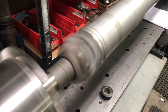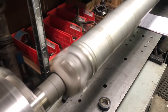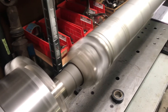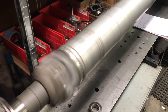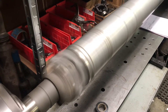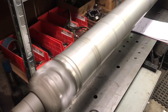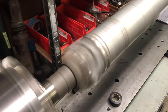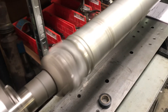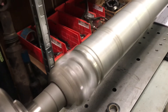It had had a DIY U-joint change, and a lot of these — this happens to a lot of these — it just sends these things absolutely crazy. These aluminum shafts work okay. The AAM ones, I mean I'm a Dodge guy, but this isn't their best work ever. They're just always filthy with weights, and their weight packages just defy description, basically. Take it from a guy that's been balancing drive shafts a long time — these things work, but when they get knocked out of whack, they are out of whack.